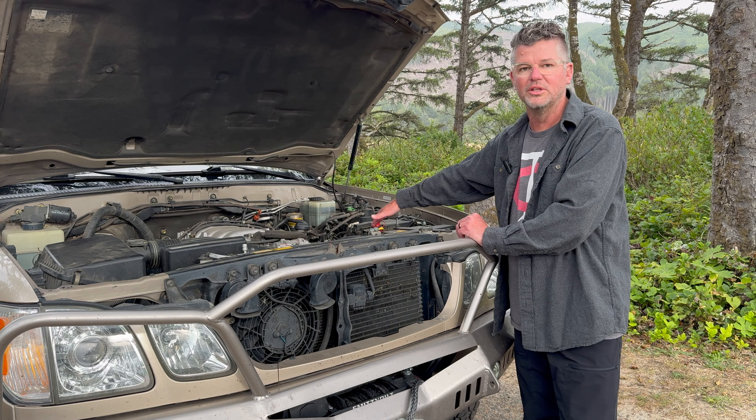We also upgraded to the biggest possible battery that would fit in this compartment, because we don't currently run a dual battery setup. This has much higher cold cranking amps capacity than the factory battery. I also put some very large connectors on here — you can see the cable that runs to the winch, very big, with the shutoff right here. Important: if you're in an accident, you don't want power running to the winch all the time. So this is a shutoff for the winch, a circuit breaker panel, and a fuse for all the stereo amplifier things in the back of the car. This allowed me to retain the factory fusible link as well as add my other accessories.